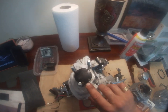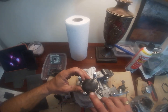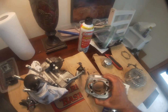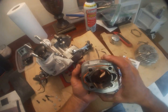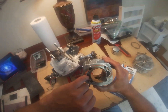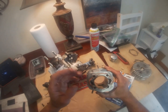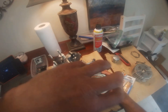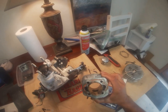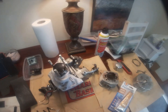As you may be able to see here on the piston, it does show it accurately coming on top, so everything's functioning there pretty good. I do have a lip on the top of the transfers where the steel sleeve overlaps and it comes back up through, kind of creating a little pocket there. Not super happy about that, but it doesn't seem to be affecting anything super bad.